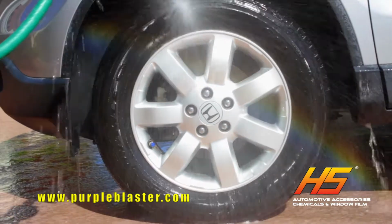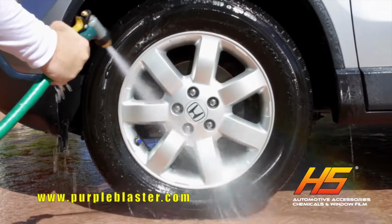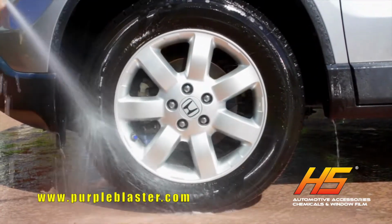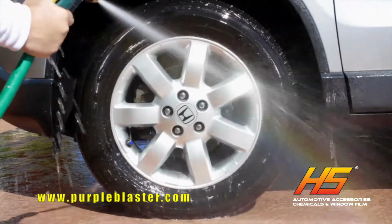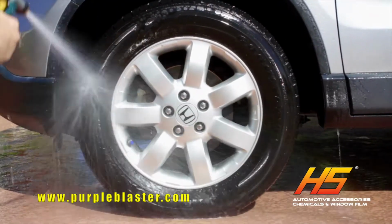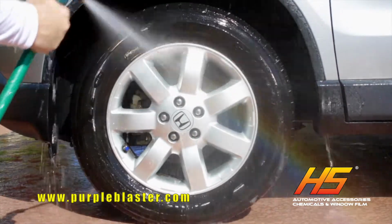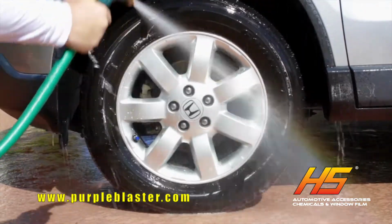With degreaser, it's very important that you never ever allow it to dry. It always works wet. As you can see, I didn't stop or allow it to dry. If you let it dry, it's not going to work better. It's actually going to be worse. You do not want the formulation to be stuck on the actual metal or aluminum. And water, as you can see, is your best friend. Always hose off thoroughly after using the degreaser.